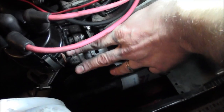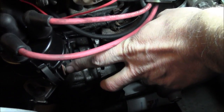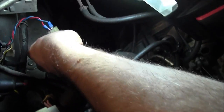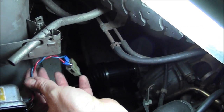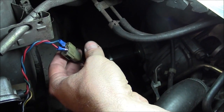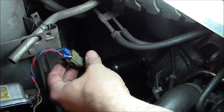Also there were these two wires coming out of the side of the distributor — it almost looks green but it's blue and red — and I fed them along through here. Still got the original plug that came off the donor car. There's a red and blue wire coming out of this transistor and I hooked them in together. You can see that's a temporary setup — I'm going to splice these wires and heat shrink them. I wouldn't leave it running like that or it could short out.